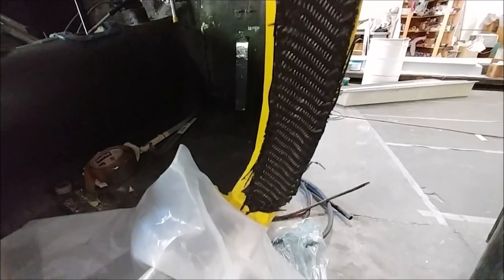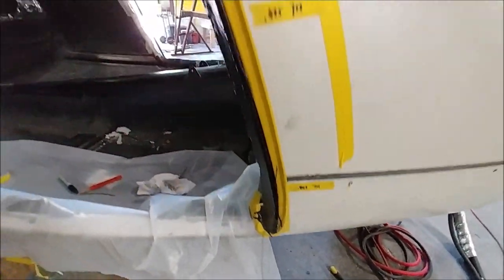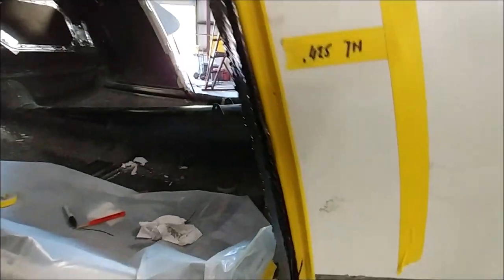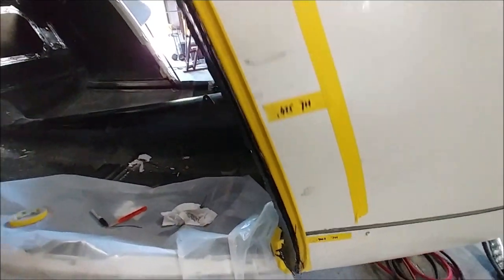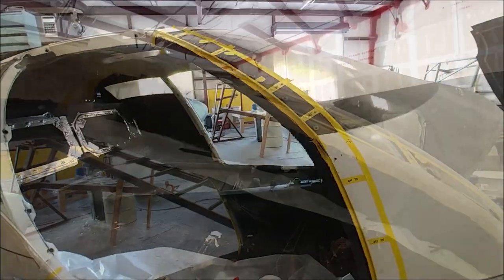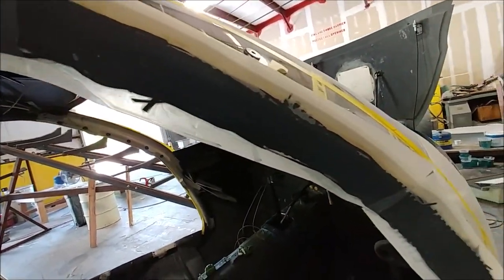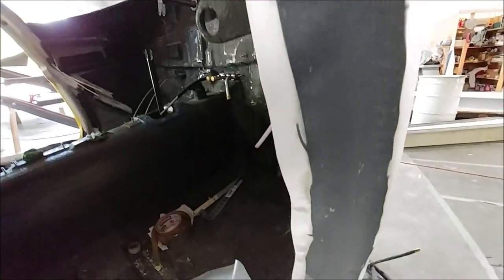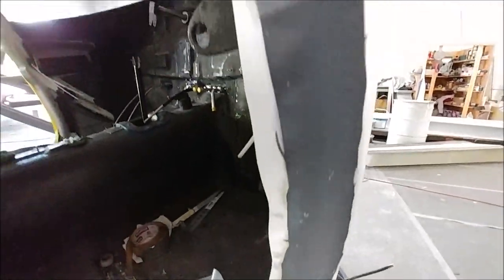Here's the layup on the frame on the passenger side, with varying different layers put down there to build up about a quarter inch at the bottom and less at the top. What's left now is to do the peel ply on there, and here you can see I put the peel ply in — I did a fairly neat job. If you do a neat job on the layup, it's less work finishing it off later.